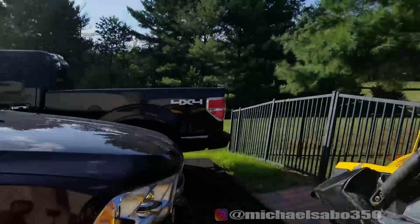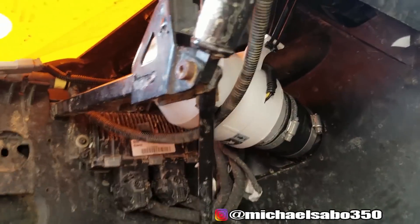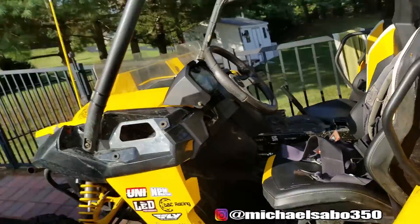One thing I did do — if you see in here, that is actually a fan that I added to the intake. When you turn it on it sucks air in and you can feel it come out the exhaust. Matt and I tested it and it does keep it slightly cooler — it gets rid of the heat soak. When you let off the gas the temperature likes to spike, and this got rid of that, but you still have to stop and let it cool down. I think the second intake duct will make a huge difference. It's just really difficult to figure out where to run those pipes where it's going to look okay and not hit your feet.